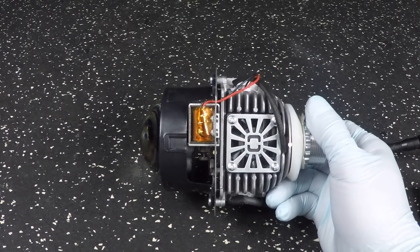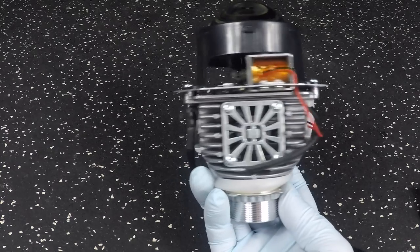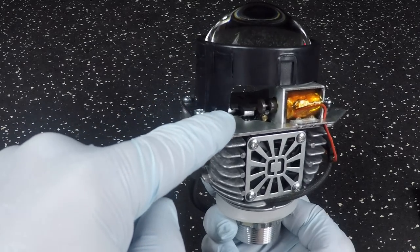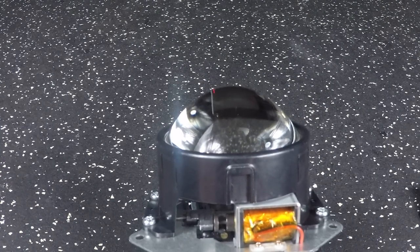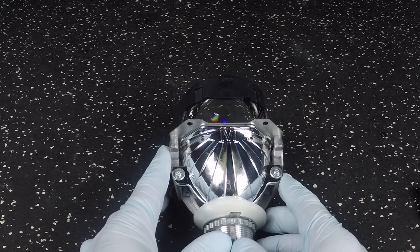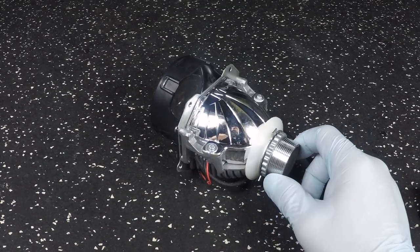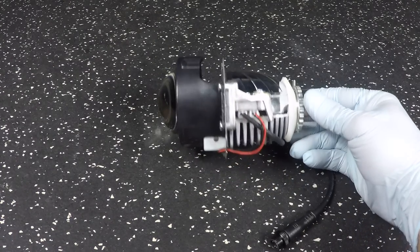With HID, there's a lot of space. We see a fan down here and really nice thick cooling fins. Once I turn that unit on, that's going to spin. That's the high-beam solenoid — it's going to move the shutter, move that shield inside the projector, exposing the high beam. There's a clear lens on this unit. When you see the performance and the output, you're going to see how sharp it is. A lot of the other LED units on the market just aren't as sharp. Morimoto definitely came out with a really strong competitor — I haven't seen anything like this on the market. Intensity-wise, it's absolutely crazy. I don't think anything's going to hang with it intensity-wise.